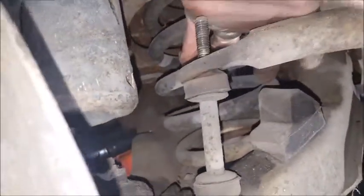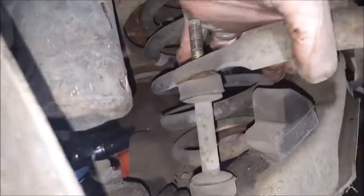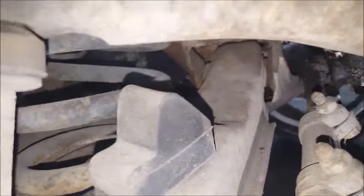Now, by the book, they say put a spring compressor on here, which I don't have, so I'm not gonna do that. And I did the other one and I didn't have to have it. But there is a lot of levering and you'll need a spare hour or two to screw with it.